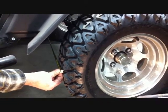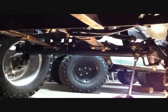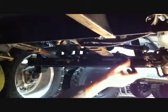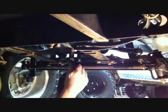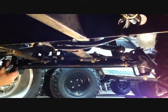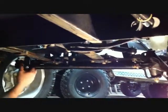Right now we are actually toed out — we are narrower in the rear than the front, so we need to adjust to toe in properly. Using a 7/8-inch wrench, loosen the jam nuts on both the driver and passenger side of your main tie rod that runs from wheel to wheel. Turn them about four turns on each side to give enough room for adjustments. There's a flat spot in the middle of the tie rod — using a 9/16 wrench, turn the tie rod to lengthen it, bringing the front in by pushing the rear portion out. Turn it a turn or two, re-measure, and once your front portion of the tires is 1/4 inch narrower than the rear portion, use your 7/8-inch wrench and re-tighten your jam nuts.